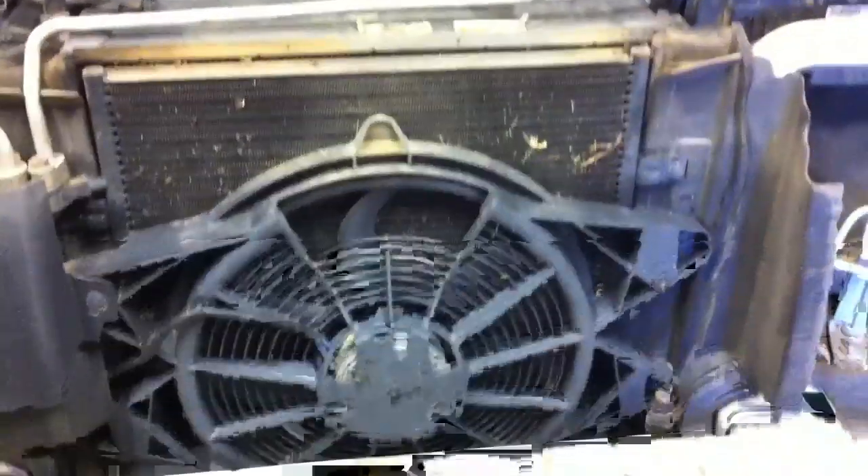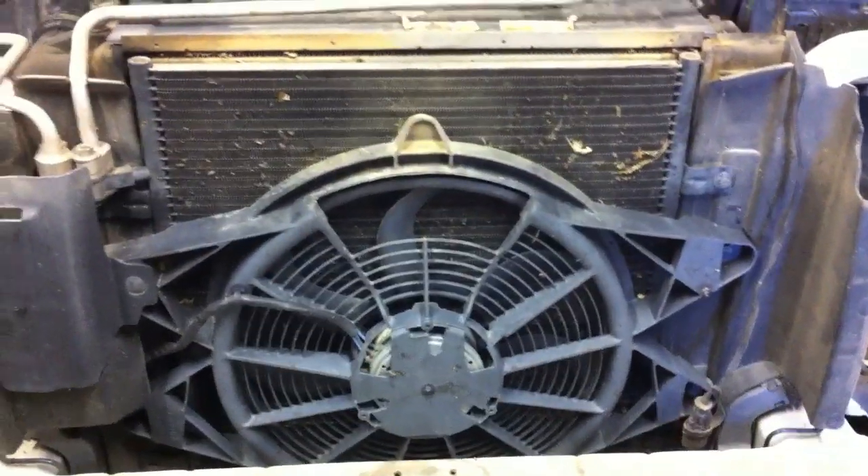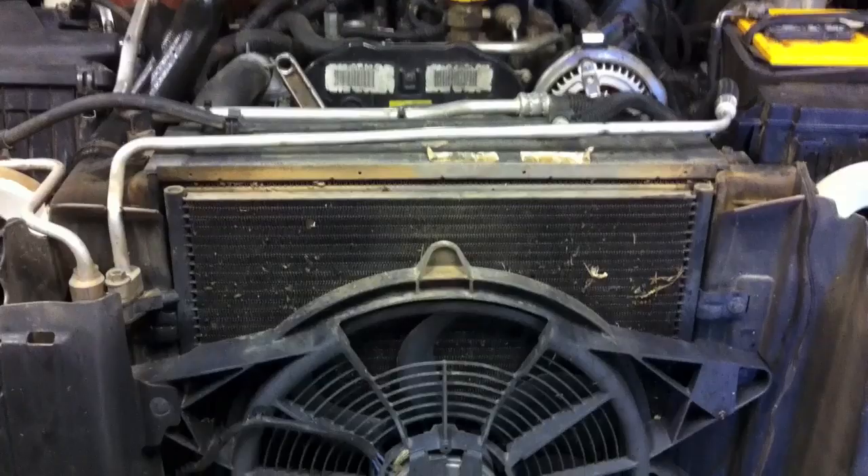This is the intercooler here. Up in the upper passenger side — upper right at the inlet — we're getting some oil coming out and coating things. It's dirty, but there's no oil buildup over on this other side. We'll get the intercooler out, clean it out, and put a little bit of JB Weld up in this corner to make sure it doesn't keep leaking. Further on back is the radiator, and getting all this stuff out of the way also gives us a lot better access for getting into the timing belt and other things.